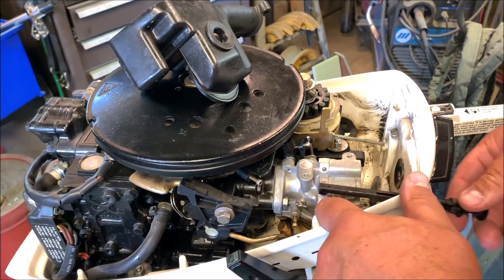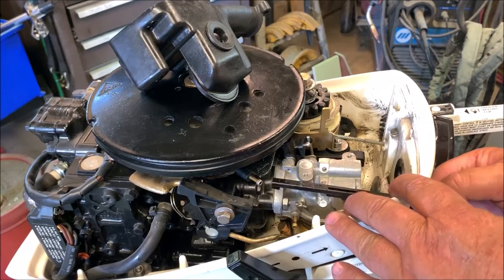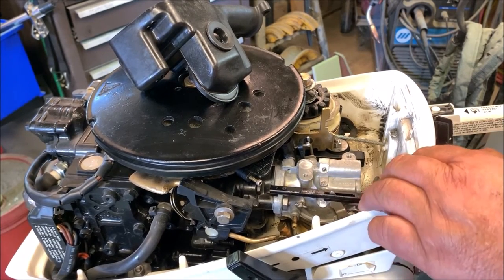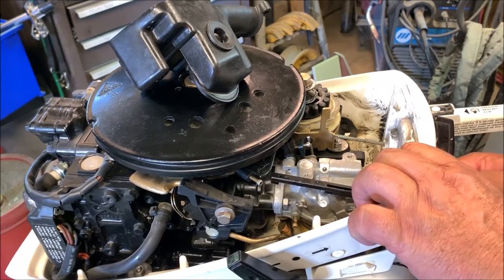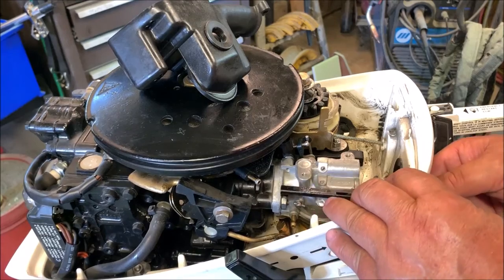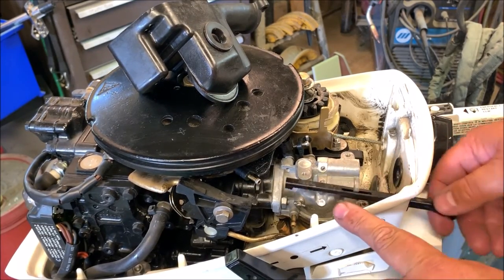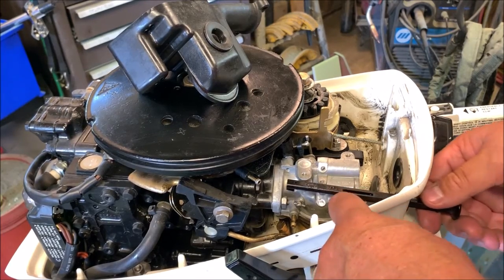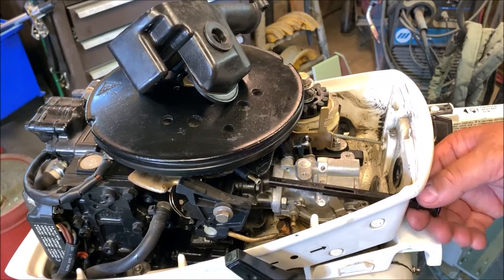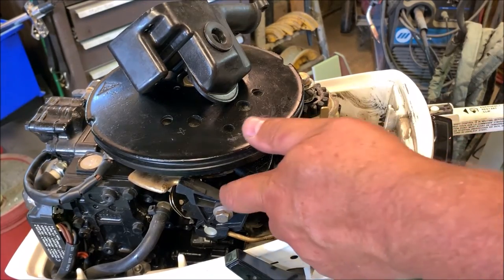We'll go ahead now and slide the choke lever back in and pop it back into place. It snaps in on the front here. Like that, so that's that there. I don't know if you see it. Oops, went too far. So that's open when it's pushed all the way in, choke when it's pulled out. And it pulls out, it'll catch on a stop.